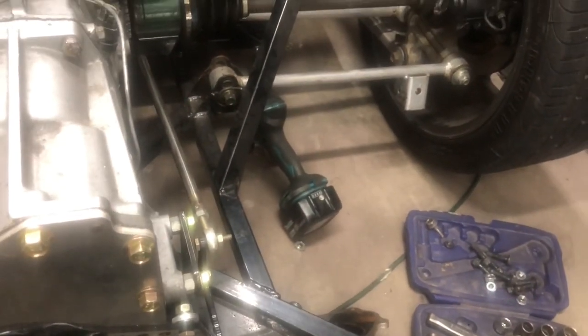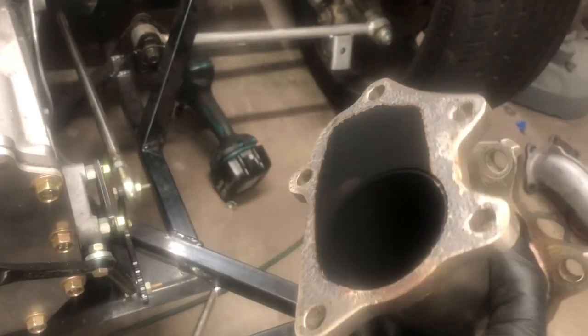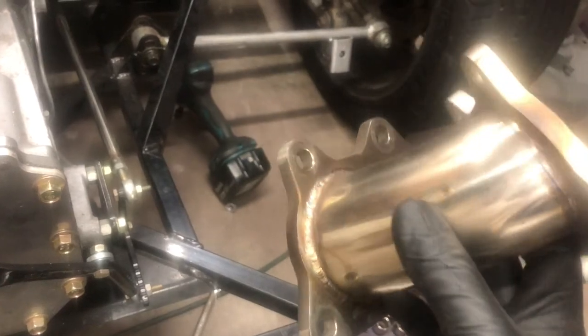And then from there, I've got two options. I barely got 17 inches, which is how big my muffler is supposed to be, to bring it out the back. If I decide not to do that, I can throw this 90 on the end of it and kick it out the side. So my muffler is supposed to be here in a couple of hours. I won't weld anything permanent or even tack it until it gets here, but I imagine that getting this piece separated ain't gonna be the quickest thing. So I'll go ahead and get started on that, trying to get this cut off and separated.